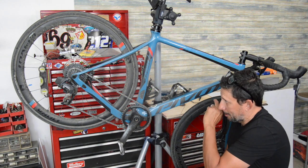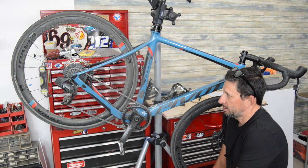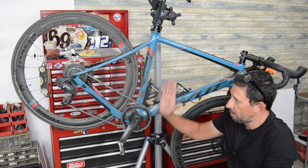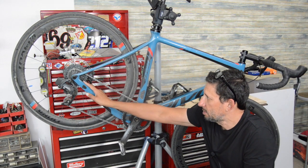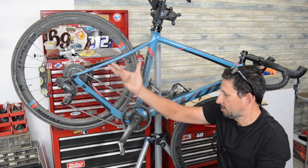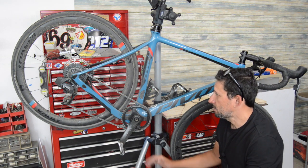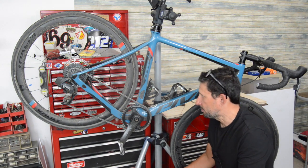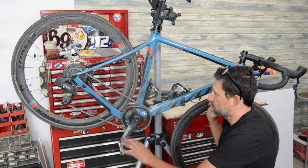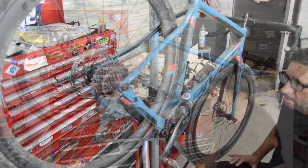With the 42T and the 33 in the rear, it's not much different from how I had most of my road bikes geared with a 53/39 and a 28 in the rear. SRAM also now offers a 10-36 in the AXS road component, which is another option for more low-end range. Or you can do the AXS Eagle setup — an electronic mullet setup — since the shifters talk to a mountain bike derailleur with no special adapters or modifications needed.